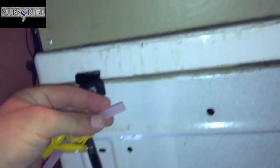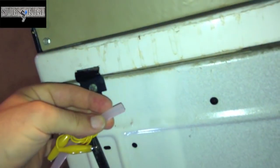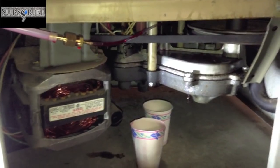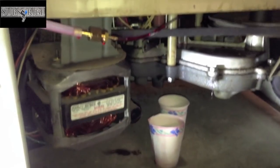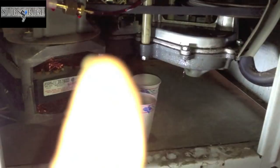To do this, I have some tubing here - I believe this is polyethylene, I think it's three-eighths inch. This is just a fill tube. It goes down here and I had to get a brass coupler to piece it together. This is eighth-inch ID, three-sixteenths OD. And the red stuff is the ATF fluid. This big square thing on the left is the main drive motor. The thing on the right is your gearbox and transmission.